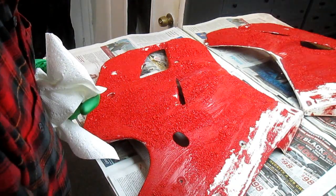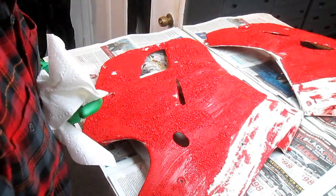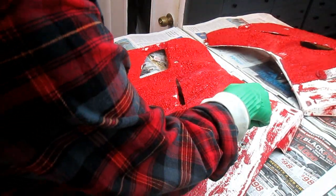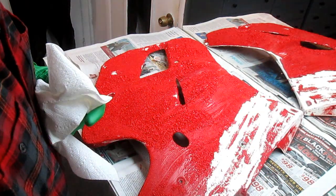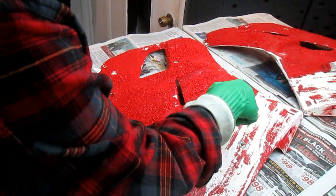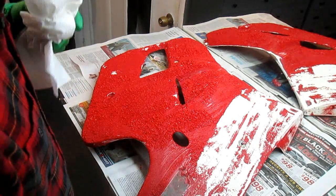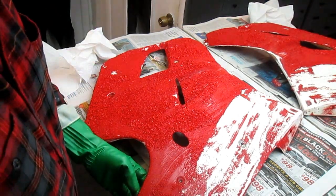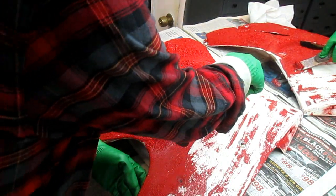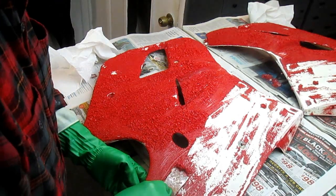And now I've used really aggressive, and I mean aggressive. I bought some stuff one time, actually at the airport, that's made for taking the finish off these really high-tech finishes that are on jet planes. And at the time I was doing a Honda 750 side cover, and it melted the plastic. But that isn't really a fair test, because back in the day of doing those older Japanese bikes, in the 70s you would do a set of side covers, and one would have a melting issue and the other one wouldn't, even from the acrylic lacquer thinner of the day. So I'm not sure about the paint remover. I don't want to wreck any more parts, but it can be mystery meat.